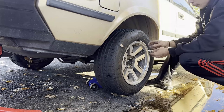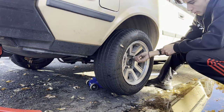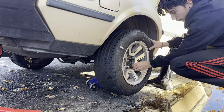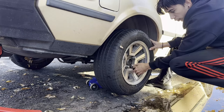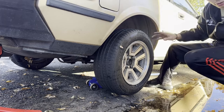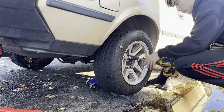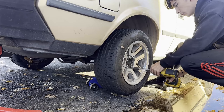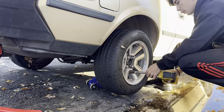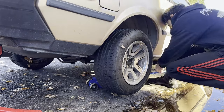These are shank style. They just have a bevel. They have a tiny one that actually goes into the wheel more to center it. The SSR Mark 1s need it. Superstars up front don't. They're fine with the normal bevel lug nuts. But if you ever buy a JDM wheel, look into what lug nuts you're gonna need, because they're all slightly different. So gotta switch back. Big boy. Looks good to me. I can take the blue jack out.